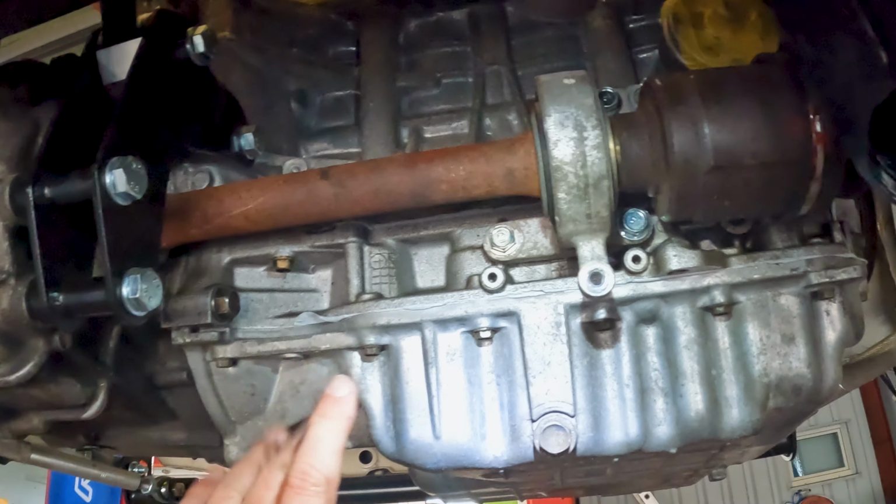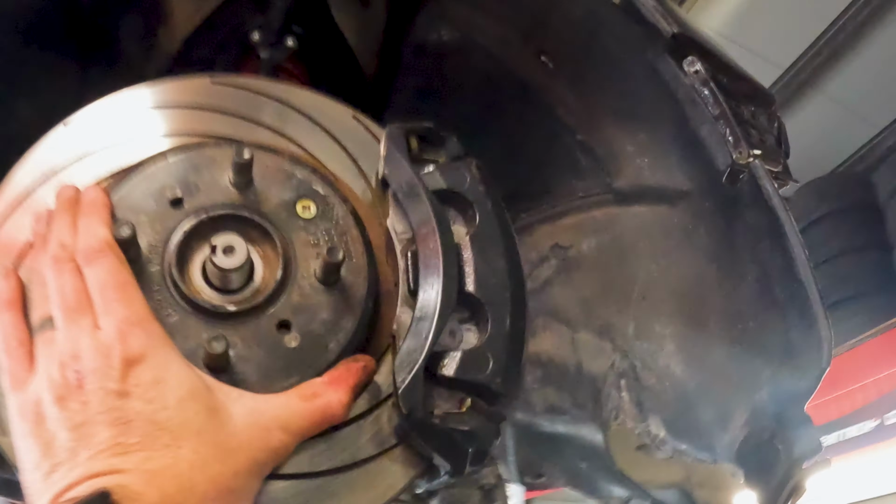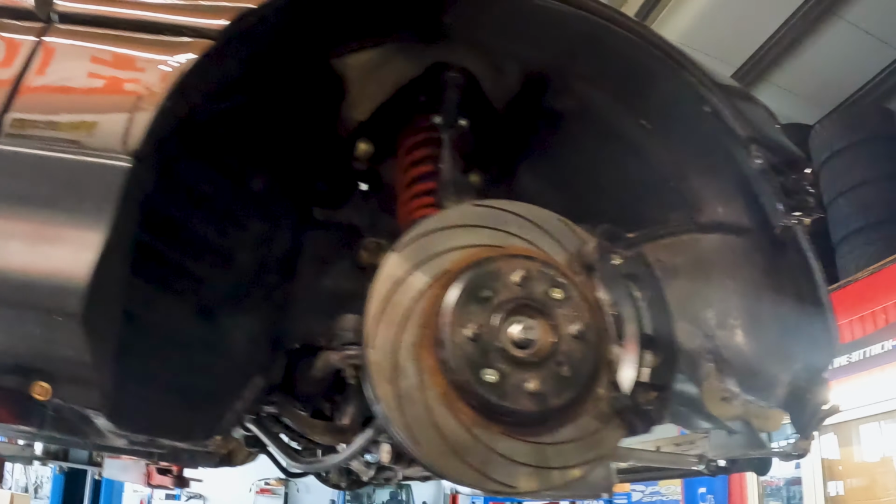Okay, so the half shaft, you need the FN2 half shaft, not the EP3 or anything else, because they're all too long and don't fit right. FN2 half shaft, and you need the FN2 right side drive shaft, and then you put the outer cups, or joints, on to fit your wheels. But there we have it. She's in. Can't be more happy.